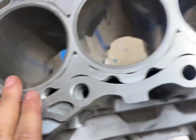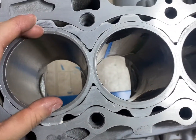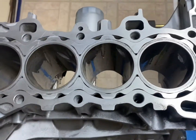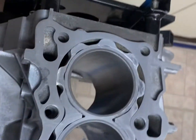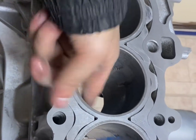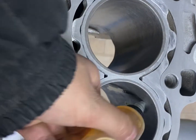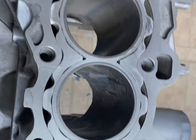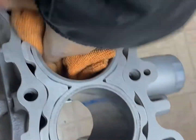Looks really well. I'm going to go across all four cylinders, flip the block over, do it again just to make sure, and then measure them to make sure I still have a 75.5mm bore size. I put some extra oil for lubrication on the sides because when you're using the hone attachment it'll leave over some grit and it's really hard to take off. But all you do is put some lubrication on the cylinder walls, grab your rag or shop towel, and just clean the cylinder walls — it'll come off eventually. You can see that there's no more surface rust and that there's cross-hatches happening. Looks really good.